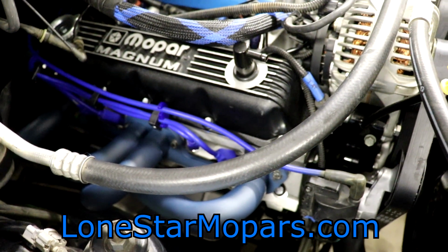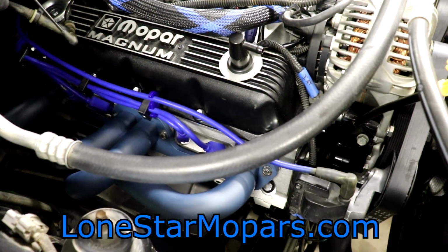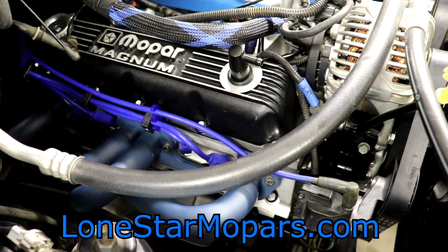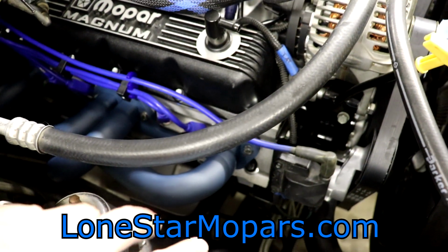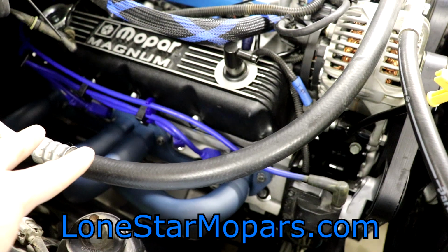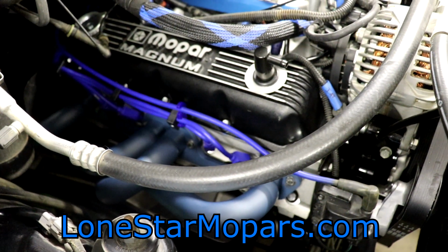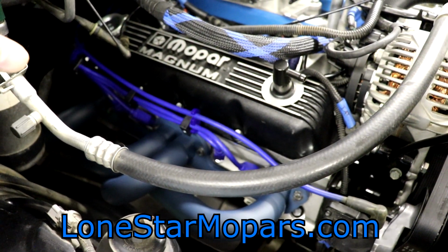There's, again, a couple of bolts you just cannot get to, especially with the torque wrench and all the attachments and everything. So 24 foot-pounds is what Pacesetter recommends. Obviously, your first bolt here on cylinder 2 you can get to fine. Second one is pretty much ridiculous. 3 and 4 you can actually do pretty good. And then the 5th bolt, kind of a crapshoot. You're probably going to have to do it with a wrench. 6th bolt you can actually access.